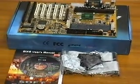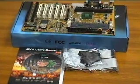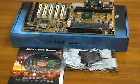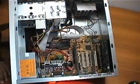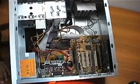It is very important that you set your jumper settings if your motherboard is not jumperless. If you do not have a jumperless motherboard, now is the time you should consult your manual and follow the directions for configuring it. You will want to configure your board so it is set properly for the CPU you have before you turn it on, or you may cause damage to the processor.